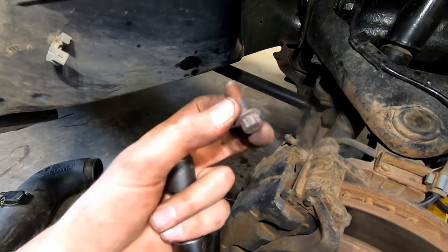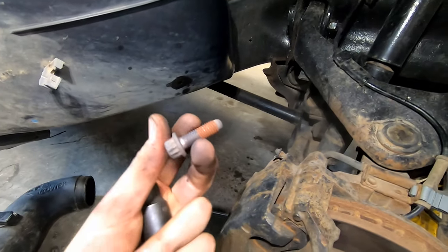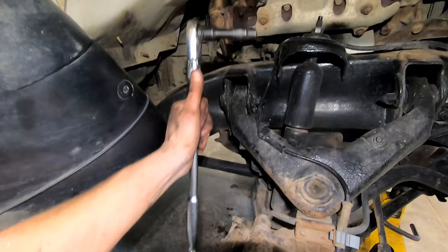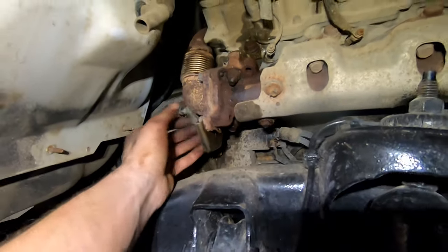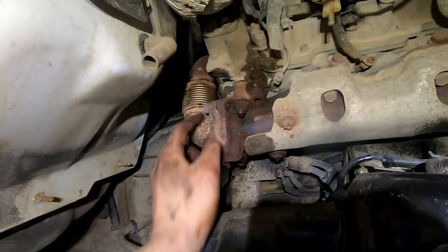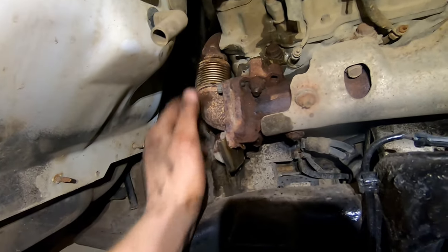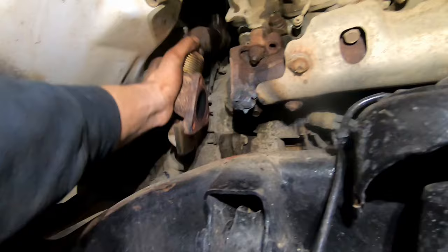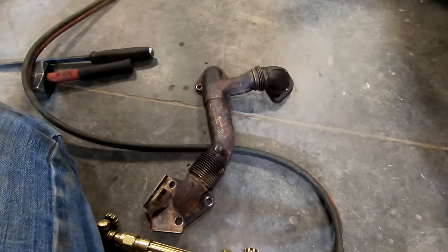I like to use a big half-inch ratchet up in here and just ratchet them loose. It's not too common that you break bolts but it does happen. All three turbo bolts came out — mine were 12-point 12mm sockets, though I've seen them six-point before. Now for the three bolts at the exhaust manifold, these can be a pain too but at least you can get a torch and heat them up. I heated them up a bit and they all came out like they were supposed to.